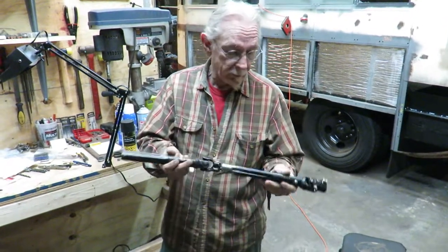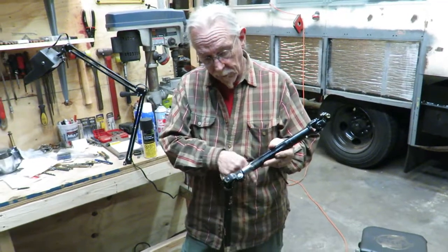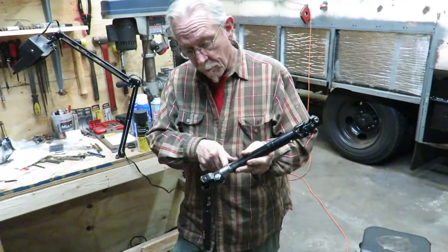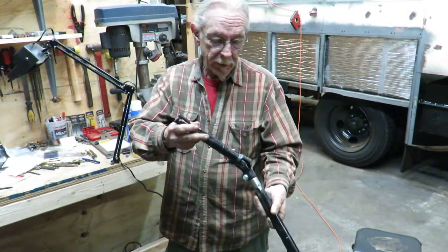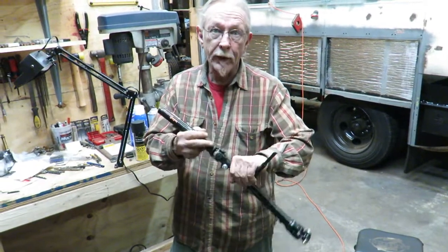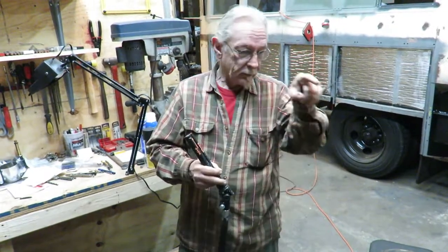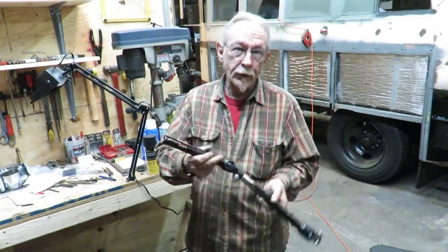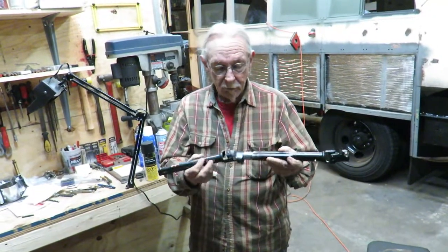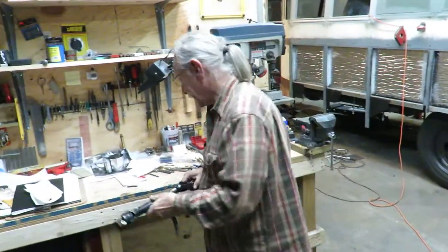Thank you, Isuzu. But then I had to have a machine shop modify this thing to get the length on it right. And this is actually a bearing surface. Because this thing's going to be at an angle like this, you've got to have a support bearing to keep the whole thing from wiggling back and forth. Hot rodders do this all the time. They may have 2 or 3 different U-joints and routing going around, all sorts of things. So having contact with some old hardcore rat rod builders was a benefit. Yeah.